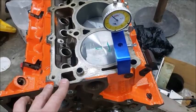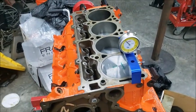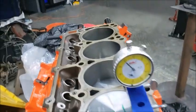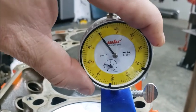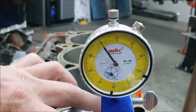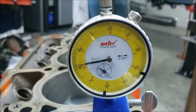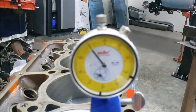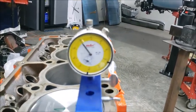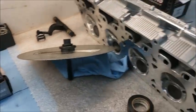Right now I'm going to get TDC set up, but since I've got this set up I'll show you one thing I always check — piston rock. Let's get this to zero. There's zero, and then this is your piston rock, because you've got to take this into account. I've got about eighteen and a half thousandths of piston rock. I take that into account — I've tested all of them already and wrote it all down.